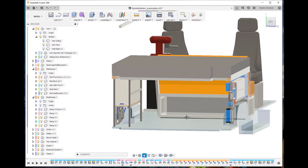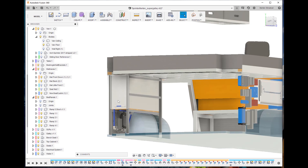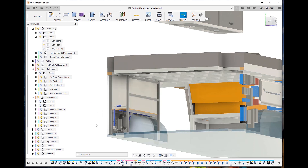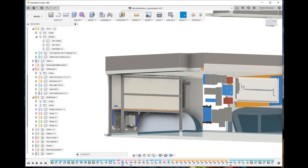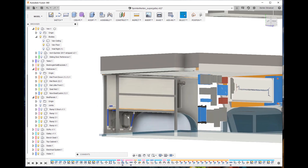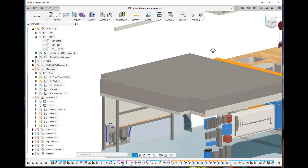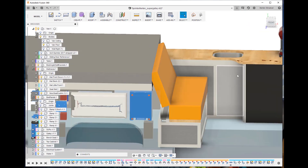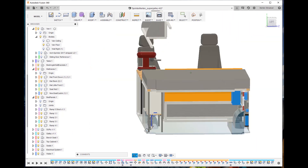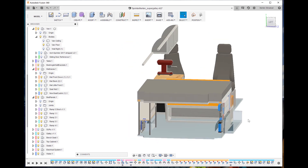On the left side I added a 21-gallon water tank — a standard tank you can get for about a hundred bucks on Amazon. Some people build special tanks around the wheel well for extra water, but I needed space for the water pump and accumulator tank anyway, so I made use of that space. There's 21 gallons here, all the PEX piping, a nice filtration system going straight to the sink. So water is on the left and electricity is on the right.